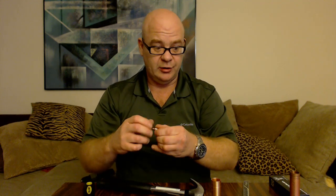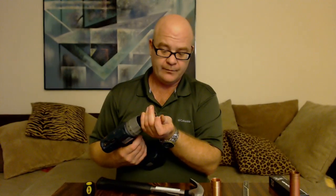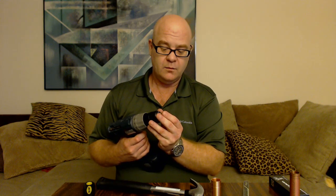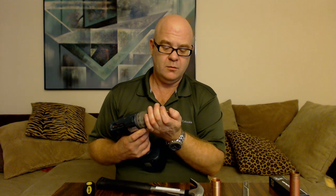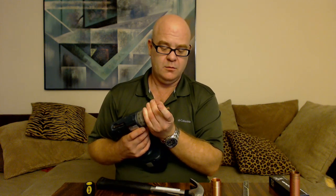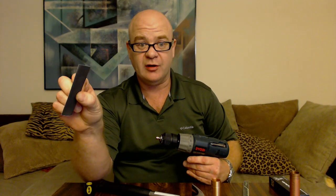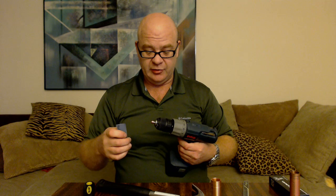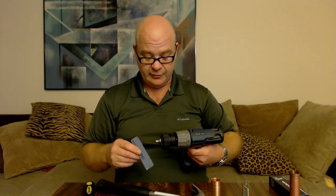Here's what we're going to do — we're just going to chuck this up on that nipple in the drill and we are going to sand it down. So what I'm going to do is take a piece of sandpaper — this is actually emery cloth, I just ripped a little piece off of a bigger piece. All I'm going to do is spin it in a drill and sand it down and fit it in the insulator until it slides nicely.